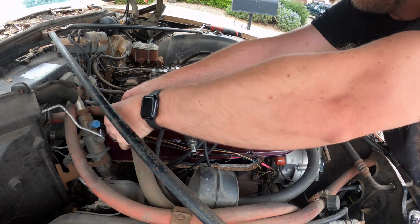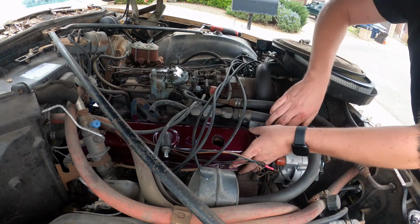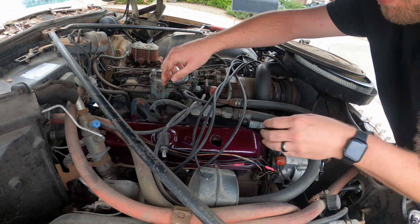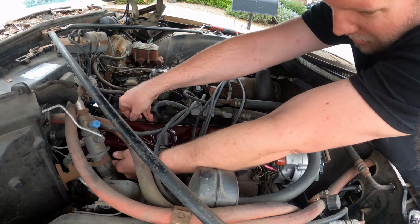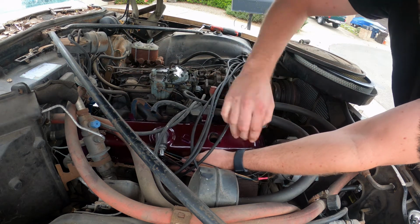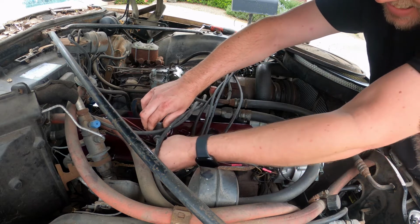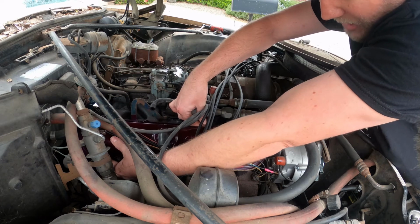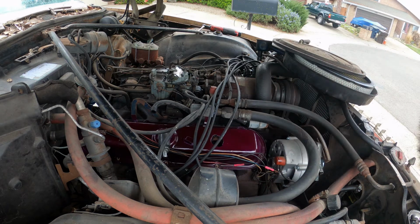Now for me, fortunately, there was no question because it's got the fill plug on the front, and so I can tell instantly where it's supposed to go. But some of the gasket material is kind of wobbly on here, so you want to make sure that everything is going to be lined up properly and not hanging off, so that when I start putting the screws in, everything lines up. I'm going to put the screws in by hand first before I start doing any sort of torque. 10 foot-pounds really is not that much.